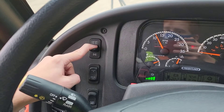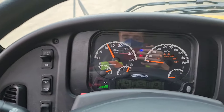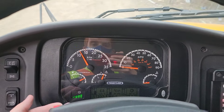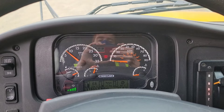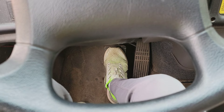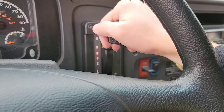Test your light switch in both parking lights and headlights on. Because it's a school bus, always run with headlights on when driving. Check your high beams — we already checked these during the light test, but this confirms they come on when you turn them on. Check flash to pass, left turn signal, right turn signal, and hazard lights. Put it in reverse and check your reverse alarm. To check brakes on a hydraulic brake bus, pump the brake pedal three times, then on the third pump hold for five seconds. Make sure the pedal does not move — if it moves or sinks, you've got a leak; if it springs back, you've got air in the hydraulic brake system.